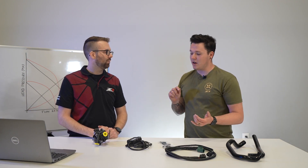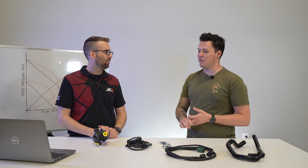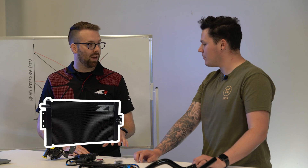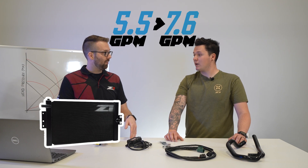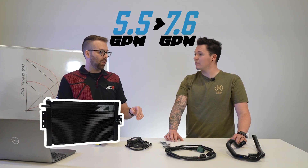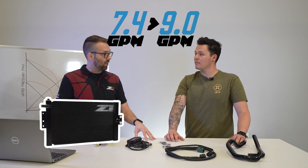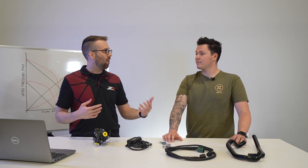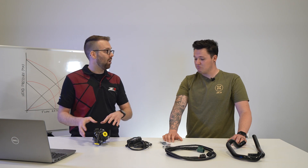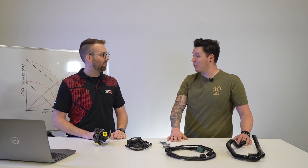So what are the numbers with all the bolt-ons — our heat exchanger, our pump, everything? If you put our heat exchanger on a non-Red Sport Q50 or Q60, your flow rate just with the heat exchanger will jump up to 7.6 gallons per minute, which is a little bit more than a Red Sport. If you have a Red Sport and put our heat exchanger in, it'll jump up to 9 gallons per minute. If you have our heat exchanger and our pump kit together, you will get 10 gallons per minute of flow through that system — on any car you install both on. That's a really big gain when you add everything up together.